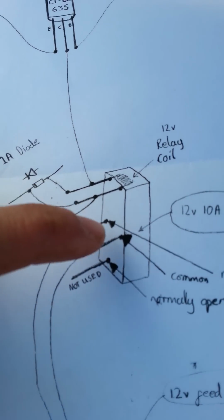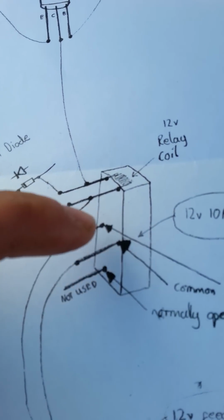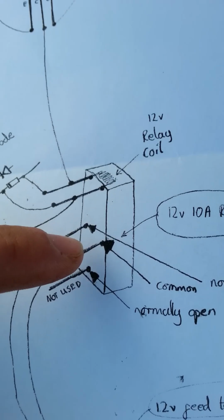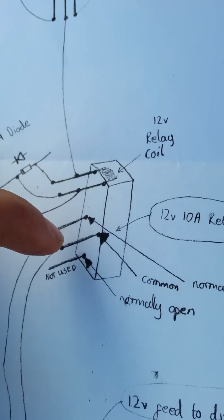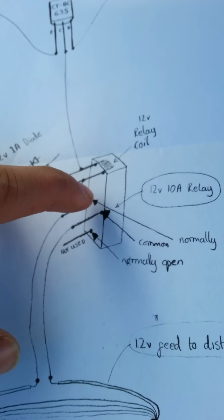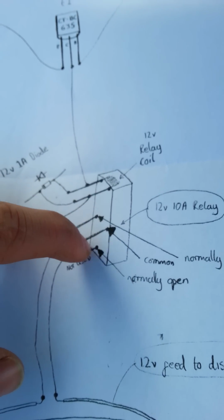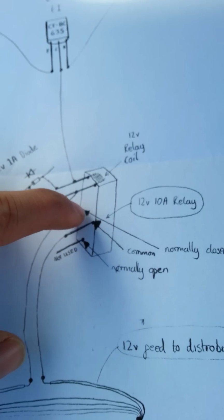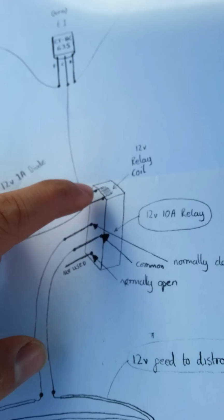When you get your relay, I'll put some notes in the description as to what part number this is from Maplin if you want it. It's only like £2 I think. It has 3 pins in like a triangle. These two here, that one's supposed to be in the middle, that one's higher. So you wire into the two closest ones to the coil.